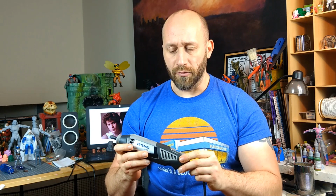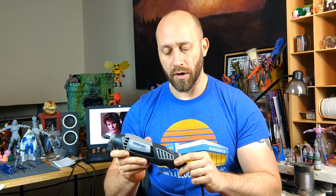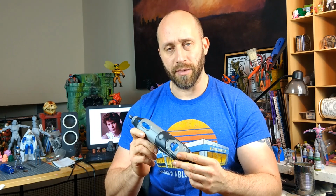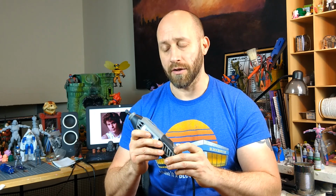And I researched if there was any troubleshooting as far as these went. And I found one fellow, and it was backed up by a second opinion from another fellow, and they both suggested that before you do anything, replace your carbon tipped motor brushes. They cost 10 bucks for 2 on eBay, and as you'll see in this video, it was a good investment of $10. So I wanted to show you guys how to replace those.